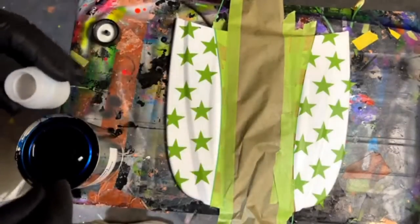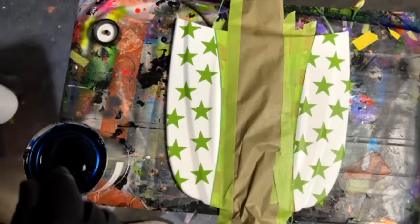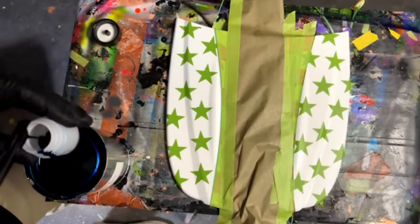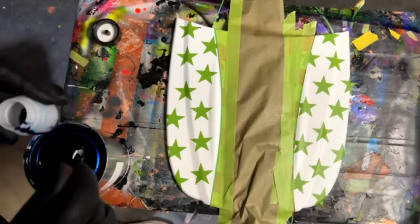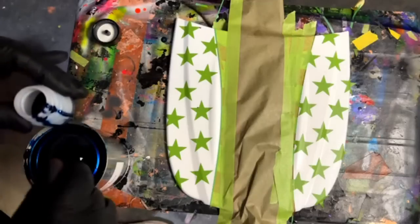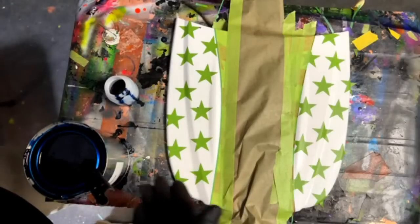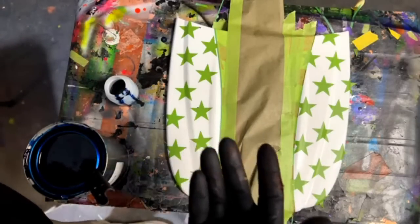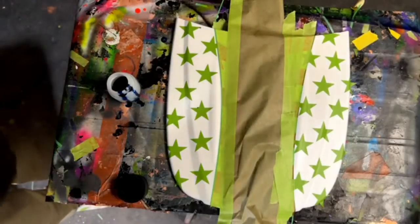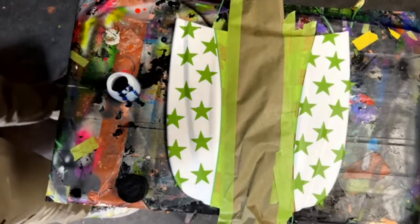All right, so I got some. This is the candy blue concentrate. Anytime you get what they call a concentrate or a toner, or candy concentrate, then you know that needs some intercoat clear, or some binder, or clear base coat, whatever you want to call it. You have to add it, because it's in concentrate form. It makes sense, like Kool-Aid. You have to put something else with it, whether it's water and sugar. With this, we need concentrate and we need binder and reducer. All the reducer does is make it sprayable. It makes it thin enough to spray smooth out of either the airbrush or your paint gun, whatever you're going to use. Okay, so we got that.